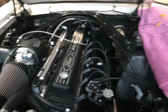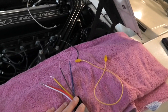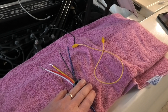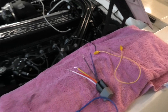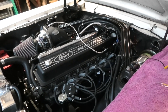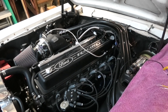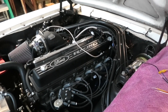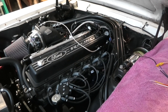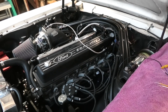It's got some weird quirks I've got to work out of it, one of which we're working on right now. I'm going to insert a clip I just took on the phone here in a minute. I'm hooking up what's called IAC kick. IAC kick is for air conditioning — that's what Holley has it in there for — but basically what it does, and you can do it with a Sniper too, is it's an input you hook up to a 12-volt source, usually your compressor clutch, that instantly raises the IAC some predefined percentage.